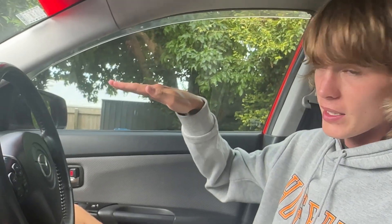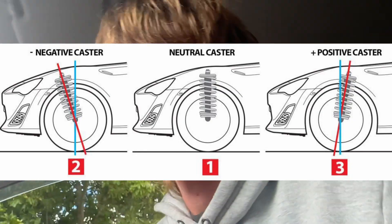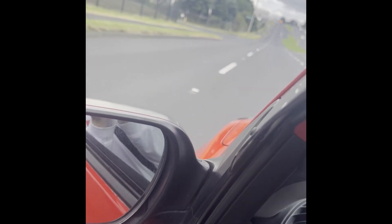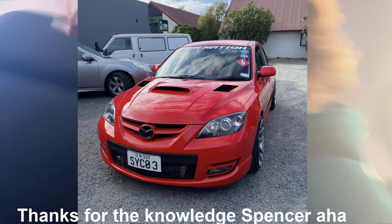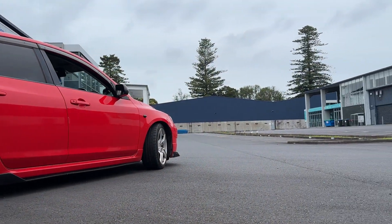I think, if you've got the control arm here, the bush lowers it so you get more caster. If you know what caster is, it will make sense. Foot flat to the floor, foot on the clutch, you dump it — then you just get wheel hop. Apparently, this stops that. There must be something bad about it though: it will make your steering a bit heavier. If you struggle with heavy steering, that could be an issue.